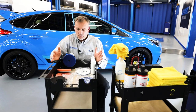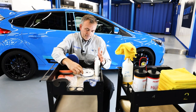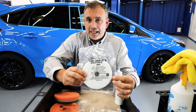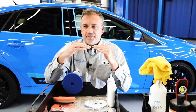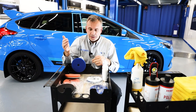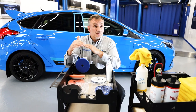I've gone for the HDO pad range here — foam pads, not microfiber. For reference, here's a microfiber; they call that a cutting pad, very aggressive cutting. We sort of change levels of abrasion into cutting and polishing. Then you've got heavy polishing, medium polishing, fine polishing and almost refining. Likewise, you can have heavy extreme cutting and light cutting. So we've got two categories: cutting and polishing.